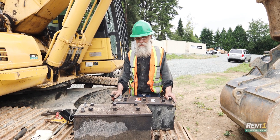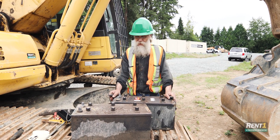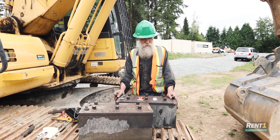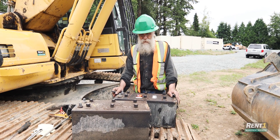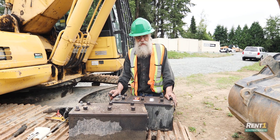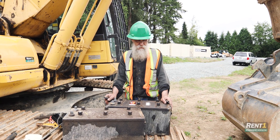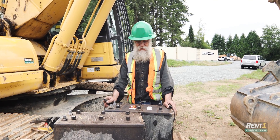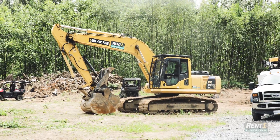Now that we've got the batteries out, cleaned off a little bit, we'll take them up to the shop, hook them up to the battery charger and give them a few hours to charge to see if they're taking any charge. If not, they'll need to be replaced. If they charge, we'll reinstall them, clean up the cables, and hope that that's the end of the problem. If it goes dead again, then we have to find out where the leak is that's draining the batteries.